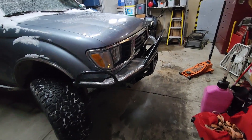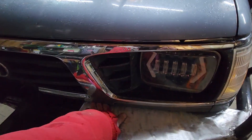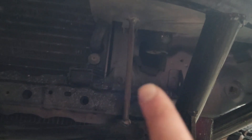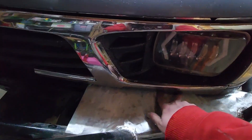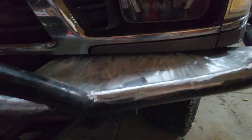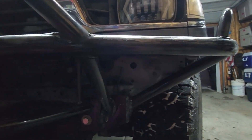My GoPro broke so I haven't been doing any updates, but I've been getting this done. She's pretty ground down. I still need to grind the weld from the back support — which is right there, that bar — same on the other side. Makes this super duper strong, doesn't bend, doesn't deflect. So now what I'm going to do is get some light bar mounts in here, and I'm trying to hide the bolts underneath, which gets the lights really far in but also makes it more cosmetic.